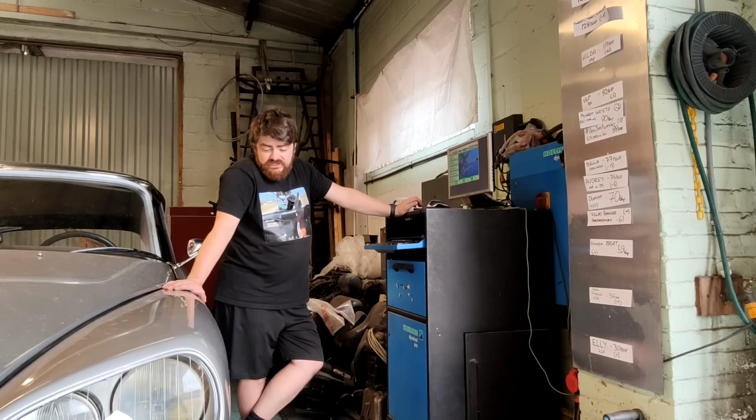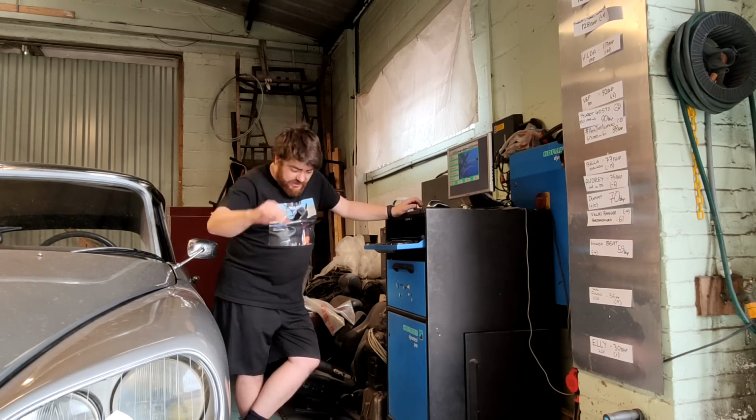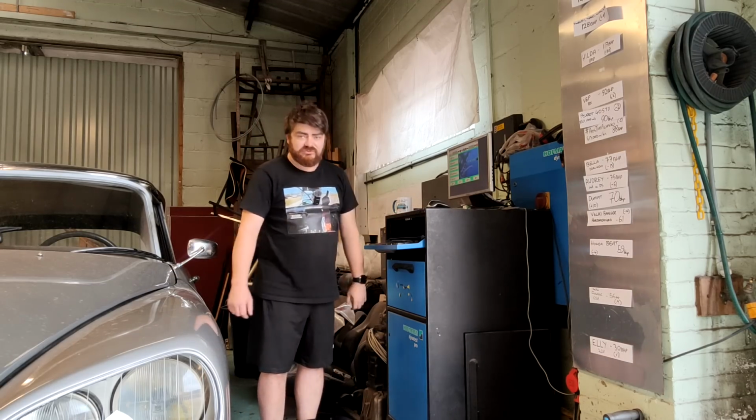If it conks out on the road now, but it doesn't conk out in the dyno, it's obviously something to do with movement, which would point more towards either something fuel tank related. It's a brand new fuel tank, brand new everything pretty much. Yeah, we'll have to see, won't we? Right, no change. 75 horsepower is your number. Live with it. Right. I'm going to go for a drive and break down.